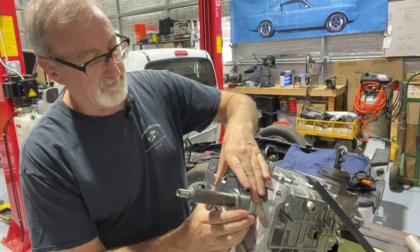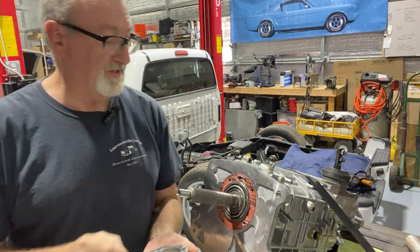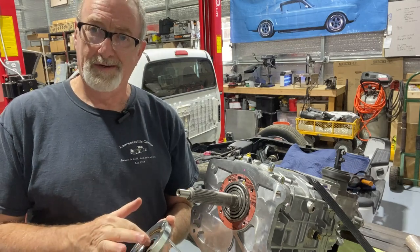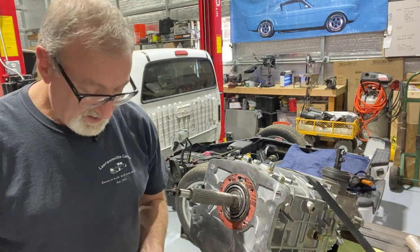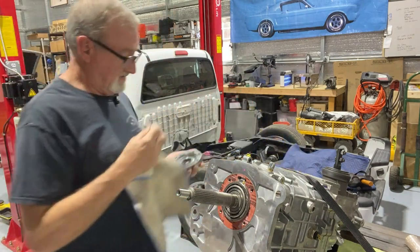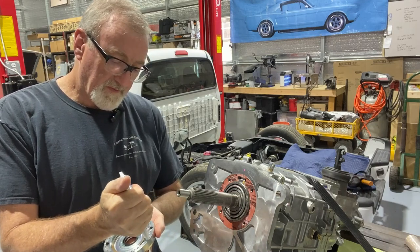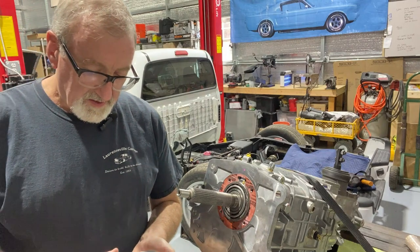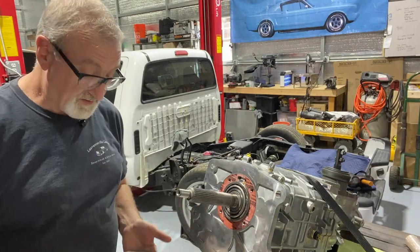We're going to slide this back off one last time. One thing I am going to do when I reinsert this is put just a little bit of lubrication on the shaft and seal — it's dry — so it's not rubber on dry metal; it'll help it slip around a little better. We're going to apply the Permatex under the bearing surface — first let's wipe it off — then spray that thin coat of Permatex on here. Now we're going to reinsert this with a little bit of grease.